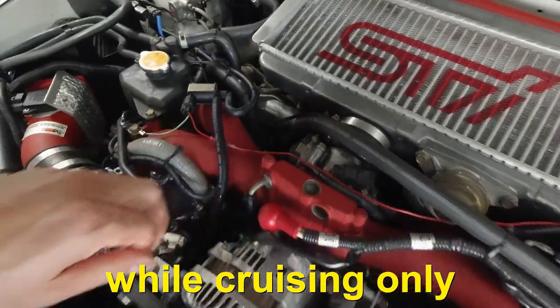That didn't work. So then, kind of by accident, well, not really, because after the tune I could actually give it the beans, I turned the switch off and went open throttle, and it didn't close. Why? Because the solenoid is airtight. When it's off, when there's no power to it, it remains shut. It's airtight. It actually needs pressure to close.